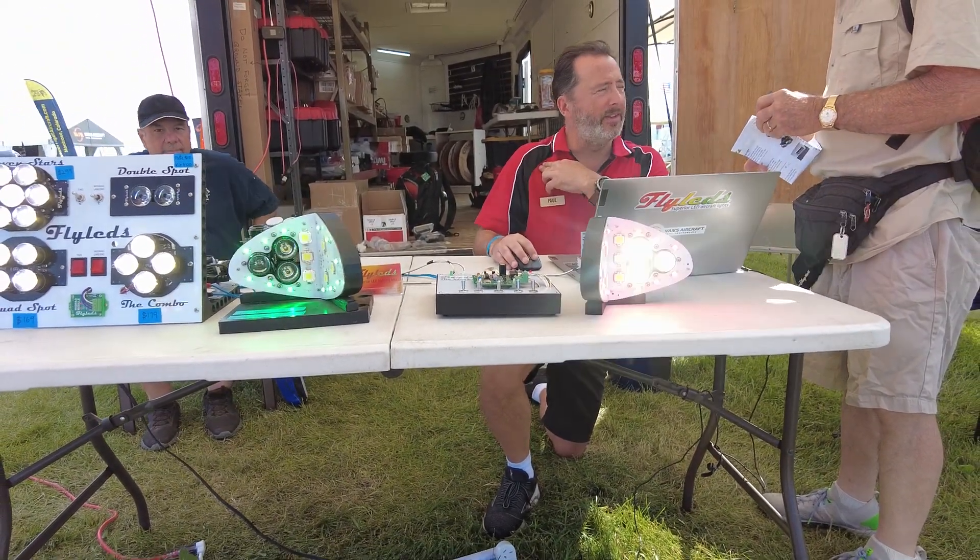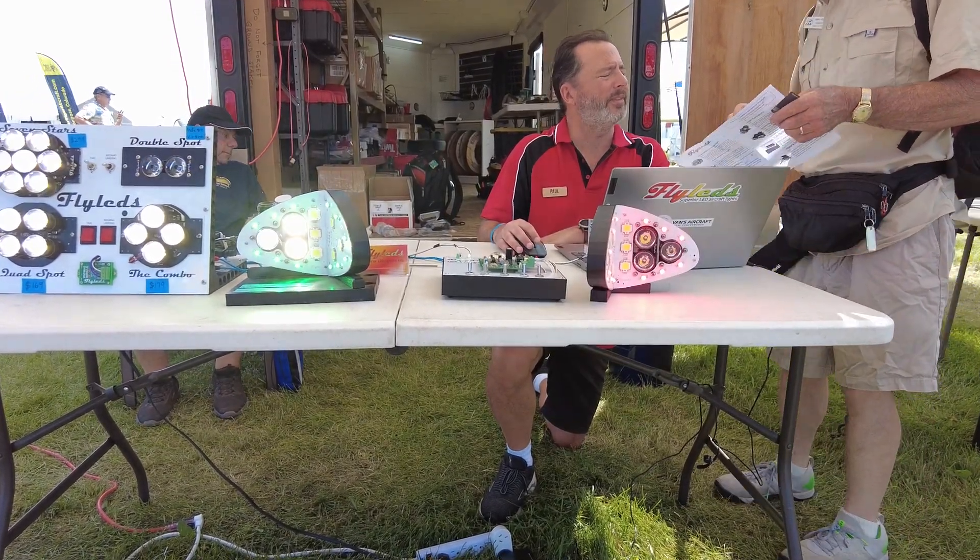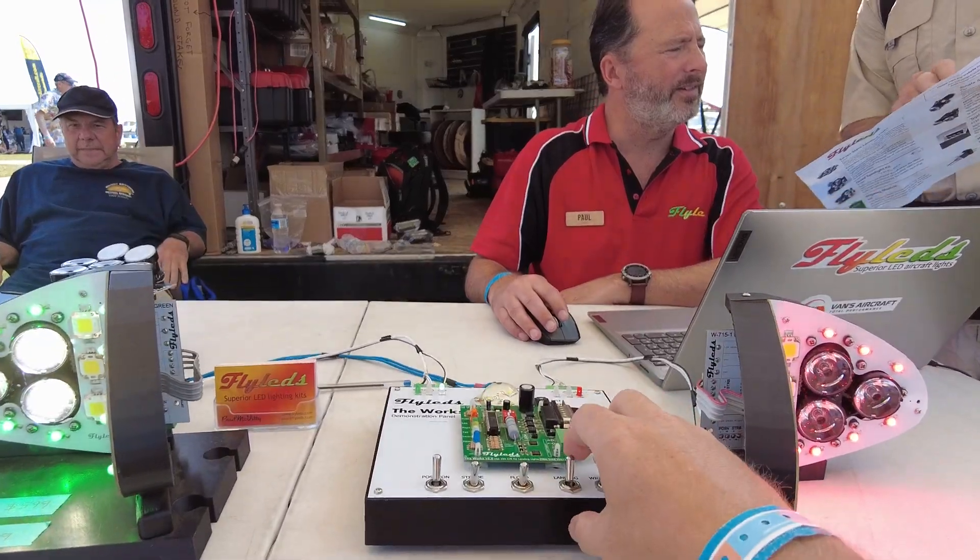We also make a circuit board that fits in place of the old-school Whelan strobe power supply. There are plenty of customers upgrading their old strobe systems. We sell a circuit board that has the same screw holes and the same white plugs — usually that's buried down the back of the plane somewhere, hard to get to. The idea is you spend about 15 minutes in the back of the plane, unplug the old box — don't toss it over your shoulder because it's actually worth money — then put the FlyLEDs board in and you're done. You can reuse all of that wiring.